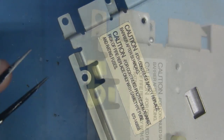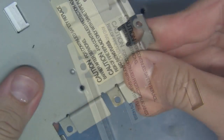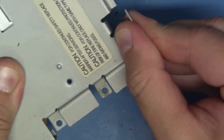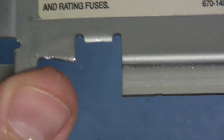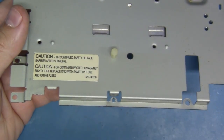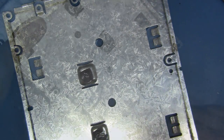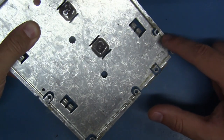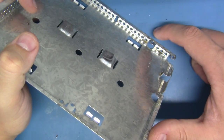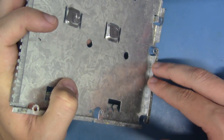Now, according to Dan's instructions, we're supposed to take some side cutters and remove material here and here from this top RF plate. That works just fine. Now we'll be working with the bottom plate. Per the instructions, we need to remove all of this material here in addition to this little nub — from here to here we need to segment that, and all of this material needs to be removed too.